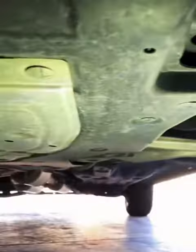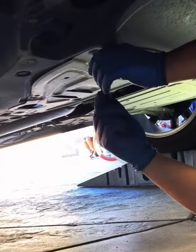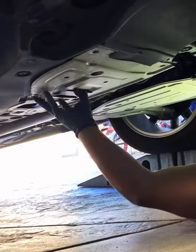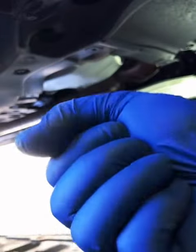Let's get serious. Today I'm gonna be using my trusty ramps to get the front end up in the air. Now like most newer cars there's always a cover underneath that you gotta remove so that you can access the oil filter and drain plug. This one has four aluminum screws that you gotta remove so you can take off the cover. And with the cover off, now we can get our catch pan ready.